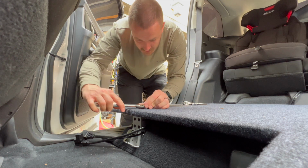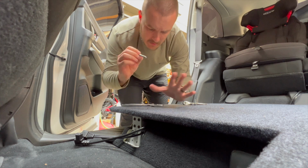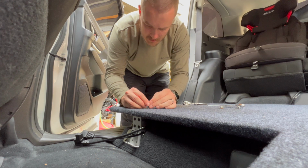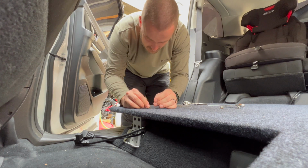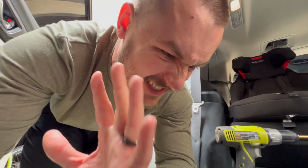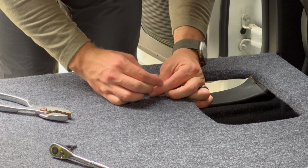Okay, so I'm going to slowly, carefully loosen. Okay, I heard a drop. Okay, so now this should go in right where the T-nut was. Oh, okay, that worked. So what I did is I took a 3/8 drill bit and I just tapped a tiny little bit off the top there, and look how beautiful that is. It's perfectly flush and it's super solid.